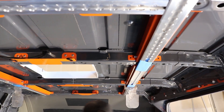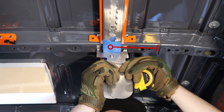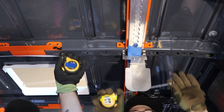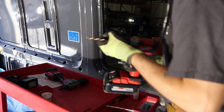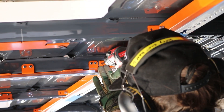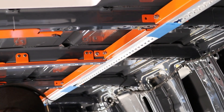There are a few places you can measure to confirm everything is parallel and where it should be: use your true center which you used to place all the cross bracers; measure the distance between the track pieces on each bracer to make sure it's consistent down the van; and measure the distance from your track to the seam on either side. All measurements should be equal from side to side. Measure all three to confirm. Trade your 3/16 drill bit for a quarter-inch — the ceiling bracers use quarter-inch rivets for more strength since they'll take the brunt of force for hanging cabinets or larger items. Start at the center because your center is set by that cross piece of track, so butt your cross piece of track up to the bracers on either side so the track is flush.